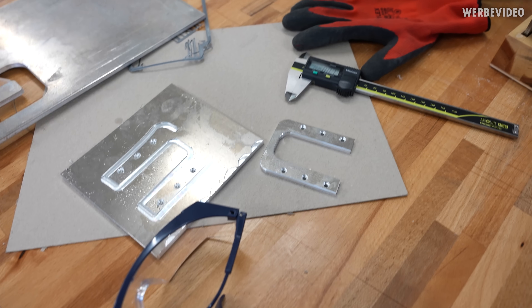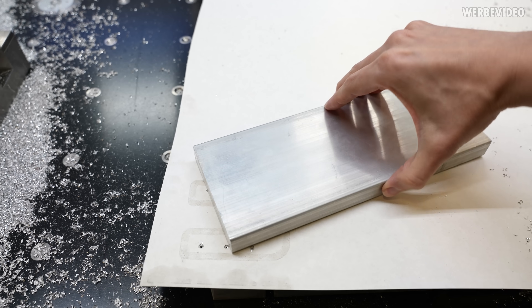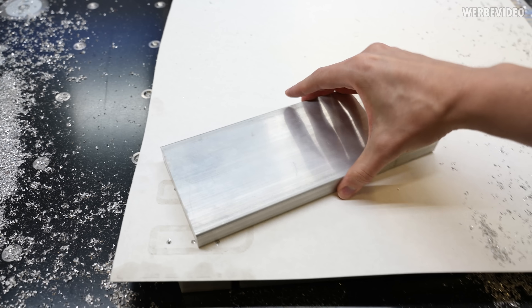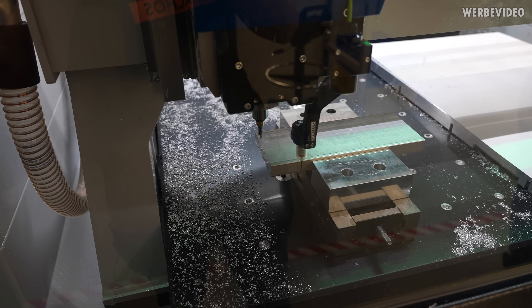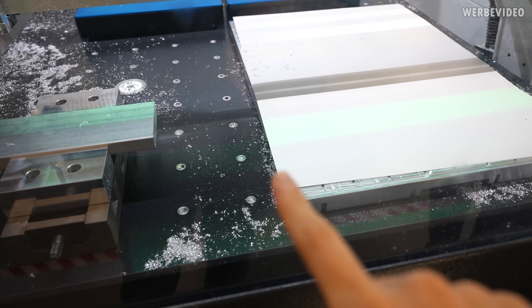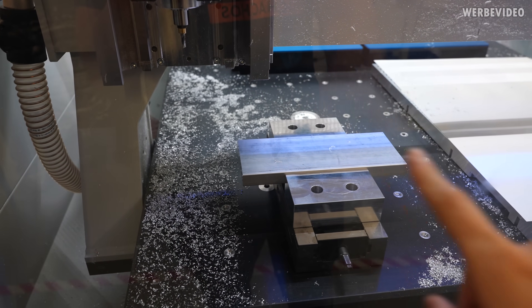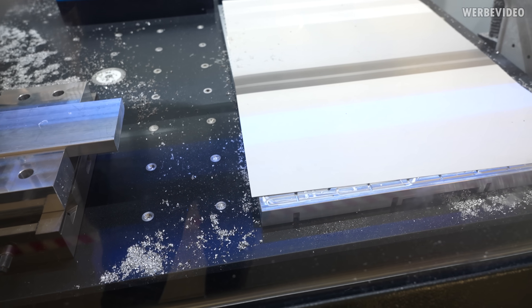It could be that we're even breaking the CPUs directly — we'll find out. The main part of the Delidimate will be milled out of this aluminium piece. The general shape will be pretty much identical to Delidimate 2. Unfortunately this aluminium piece is a bit uneven, which leads to the fact that it's not sticking so well on our vacuum table. So we first have to mill about 0.5 mm to make sure it's even and then stick it to the vacuum table.